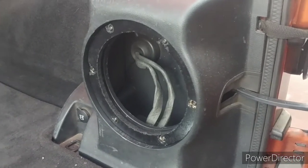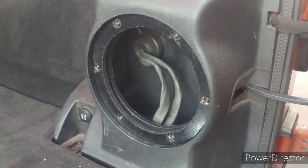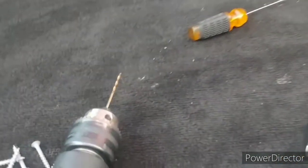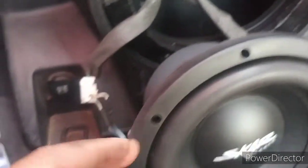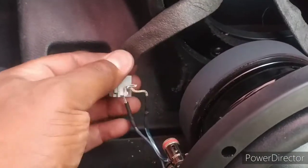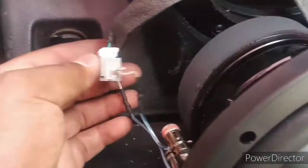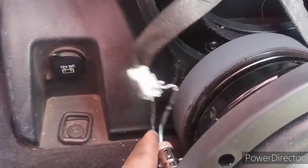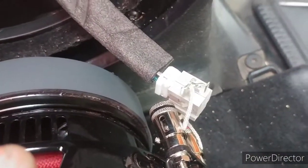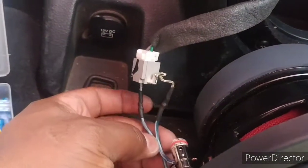The adapter's in there now — the stock bolts are actually holding it all in place and now I just have to drill my pilot holes with this thin bit. I had to do a quick mod as I was fitting the speaker in — these adapters aren't wide enough for the connectors to fit through. So I went and grabbed some speaker wire, used some heat shrink, and that gives me enough to sit the connector as I slide it in. The other side I can hook directly to it. I only had to add wire on one side, not both.